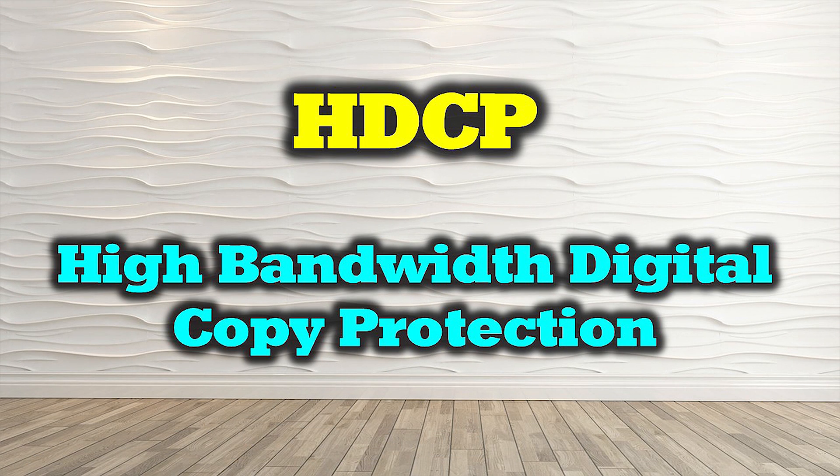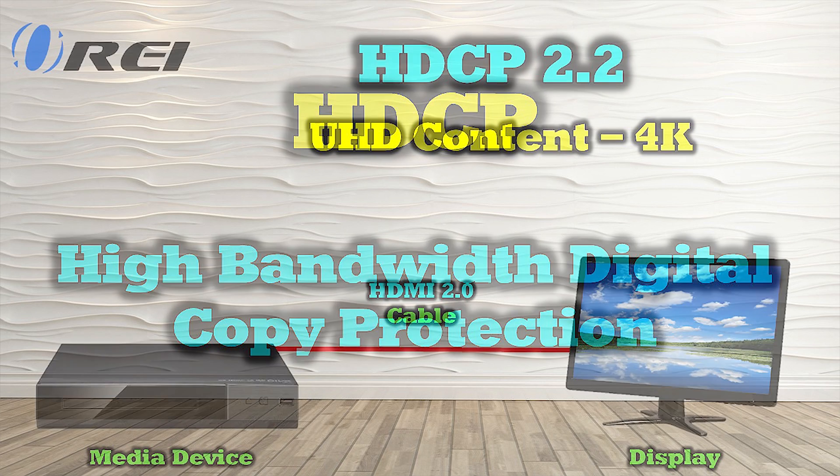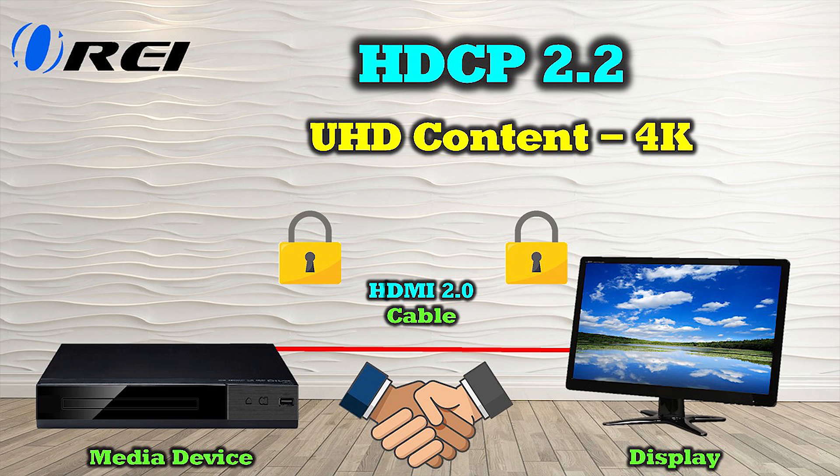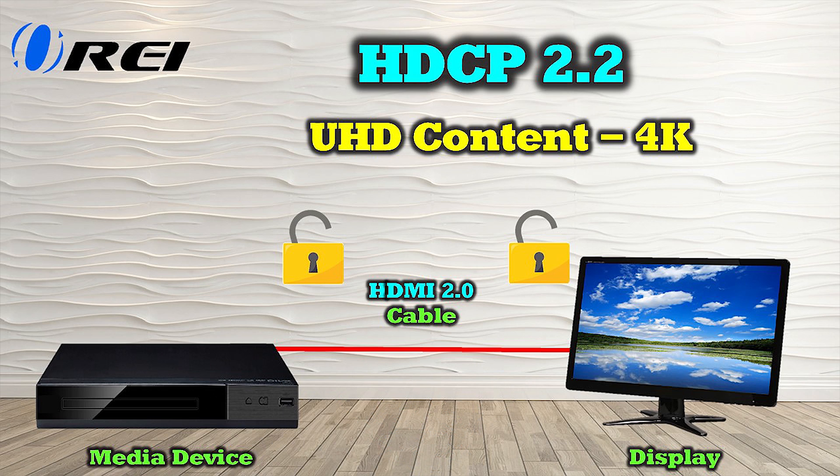This last feature of HDMI is called HDCP, and it's a really important one because a lot of consumers can trip over this. If you're not using the right style of cable or you have older media gear, you may have issues actually watching your content on your monitor. HDCP, or High Bandwidth Digital Copy Protection, is designed to prevent the copying of high definition content. It's a security mechanism built into most modern media devices that controls the playback of that content. When you first connect a new device to your monitor and power them both up, playback is initially locked. These two devices then perform a digital handshake to identify themselves as HDCP-compliant devices, which unlocks the playback. If either device is not HDCP compliant, or you're using an older HDMI cable that doesn't support HDCP, you won't be able to view the content.